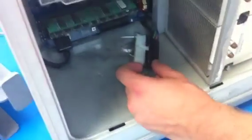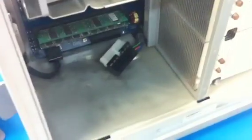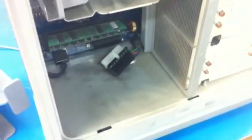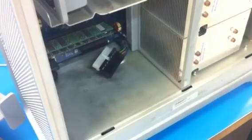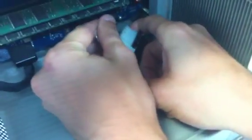I'm going to quickly teach you how to test the power supply for power. Here we have a machine we checked in with no power. In order to make sure it doesn't have a bad logic board right off the bat, we're going to test the power supply while it's still in the machine. That way we don't have to remove the power supply to put another one in to find out if it's got other bad parts or still has no power.